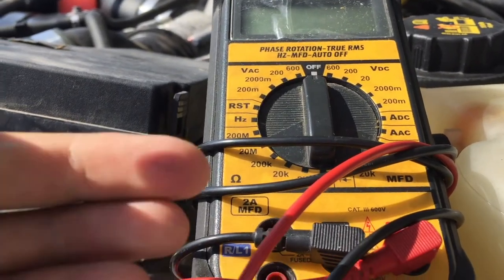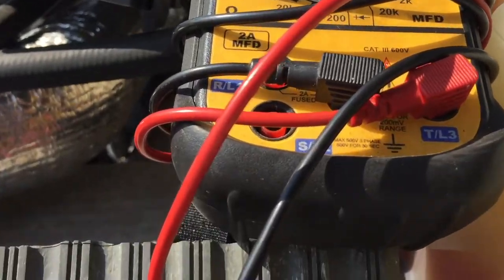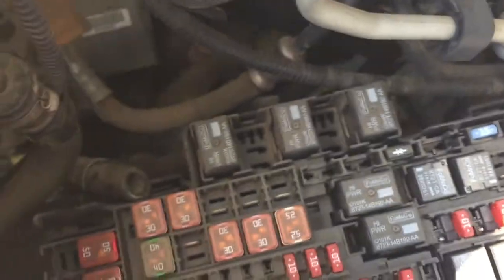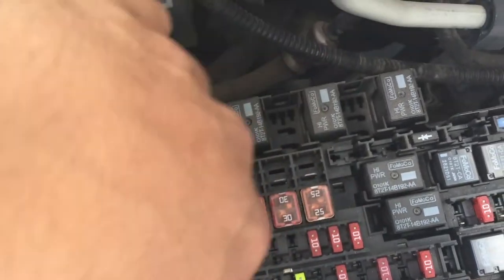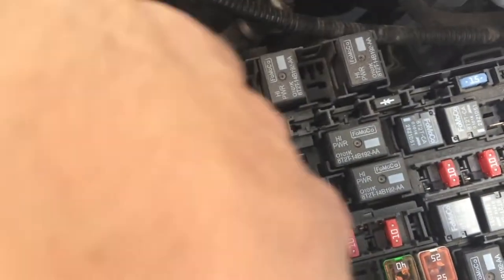This is what I plan on using — a multimeter and needle nose pliers. Here's the plan of attack: using the multimeter, I'm going to test these regular fuses, all those down there, and then these fuses I'm pretty sure I'm going to need to pull. Make sure your ignition is off, but I'm going to have to manually pull them, or maybe I can even see which one blew up. This might be a pretty short video if I can see which one blew up.